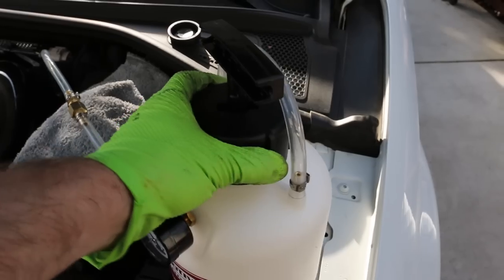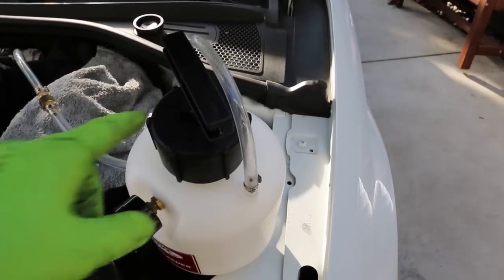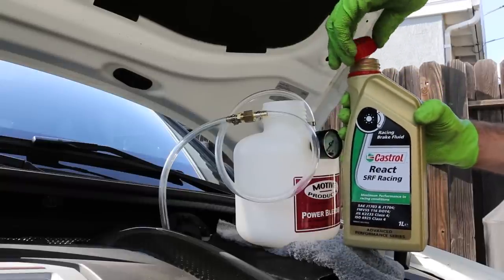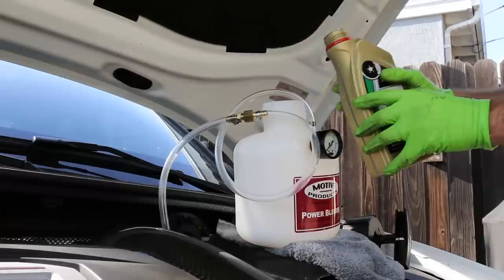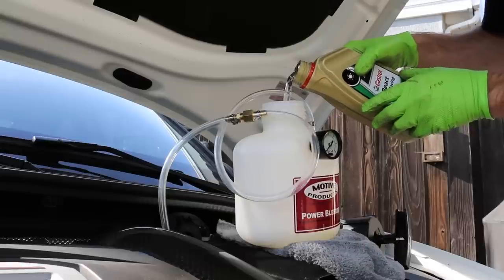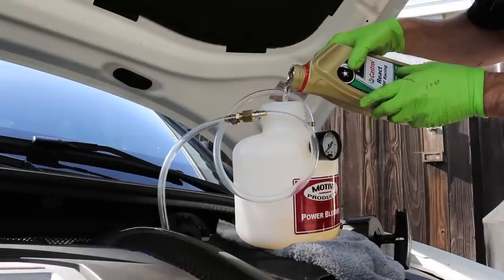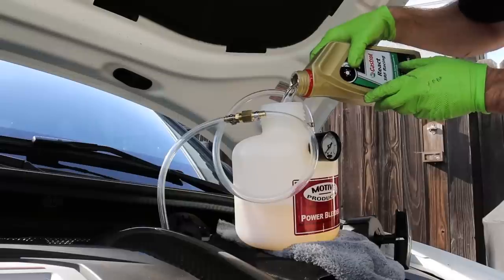At this point I'm going to relieve the pressure slowly — you don't want a rush or a bubble of fluid. Then I'll pour the brake fluid into the reservoir. Make sure the bottle is sealed and hasn't been exposed to any elements. Do not spill this anywhere as it will corrode paint. We want it nice and clean — you can see how clear this new fluid is compared to my old fluid which had a noticeable yellow tint.